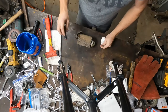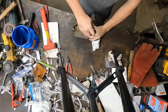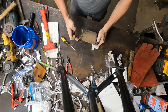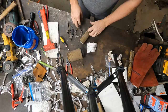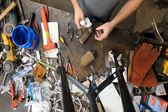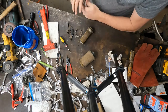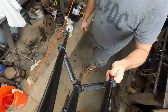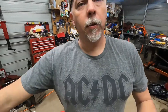This is the way this bike came in — this is terrible. Please don't let your air filter get this bad. You've got to wonder how much trash got in that engine. On the Big Reds there's an inner carrier to the exterior foam element. You want to clean this up, but here's a little secret: this is one of those yellow air filters and I don't like them — I see a lot of them fall apart. I like the uni red filter.